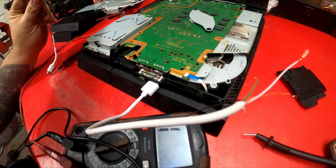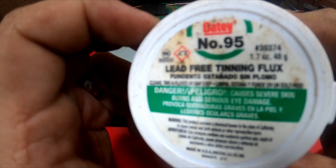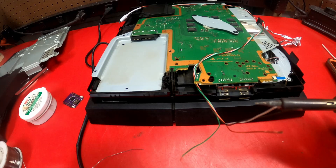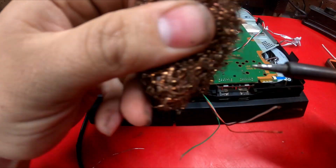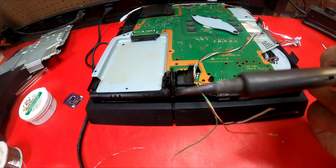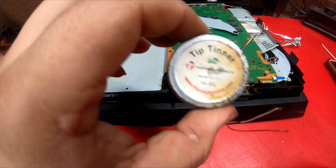Now I'm going to fit this a little tighter, and then we're going to do the soldering over here. The key to soldering well is to make sure your tip is nice and clean. If your tip gets dirty like this, just use tip-tinner.